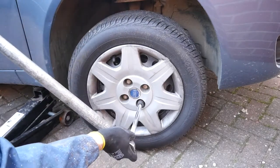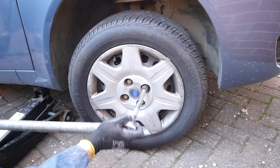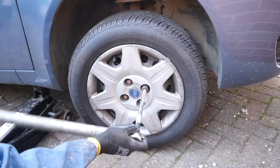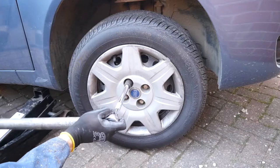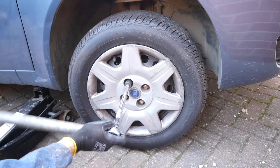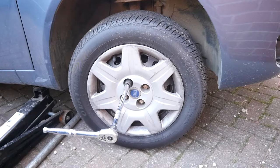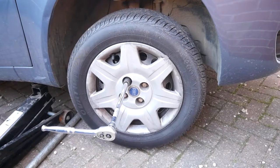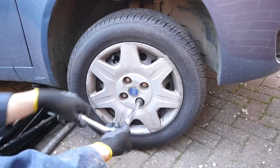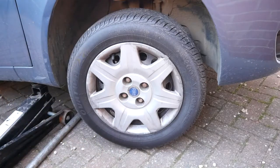You can see I need about a quarter of a turn to break the seal, and then after that I can just loosen them by hand. You don't really need anything fancy — a bit of scaffold pipe might do. Now the main torque on those bolts has been removed, I can just jack that up. You can see it's not really spinning the wheel now — it's pretty much hand tight.